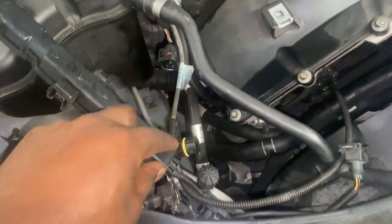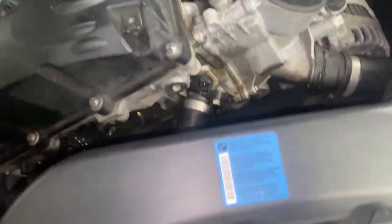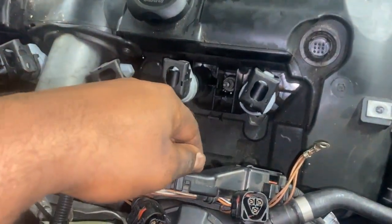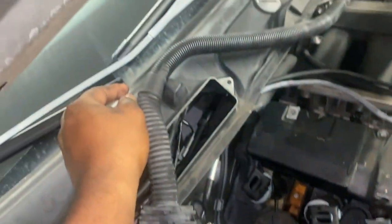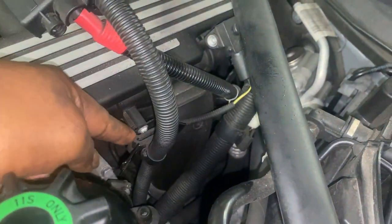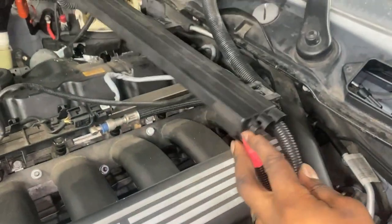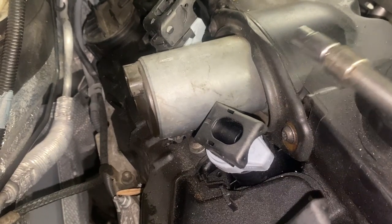I have everything tucked out of the way — wires over here, tucked over here. I also unplugged the coolant sensor, which gave me enough room to pull the harness all the way over. The coil bracket thingy I pushed to the side behind the positive jumper port. This is the most sketched part of the whole process — removing the Valvetronic motor. We don't want to mess up any of the pins. First use an E8, make sure it's a thin one, and remove the bolt at the back of the Valvetronic motor.